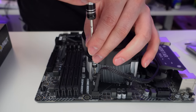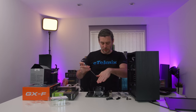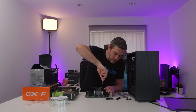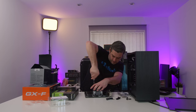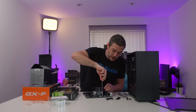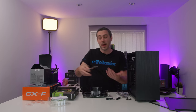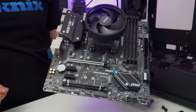When you screw it down, I always go in a cross method. Go for the first one, a little bit of light pressure, just get it to bite enough — you'll see the CPU cooler kind of goes a little bit like this. Then go for the complete opposite diagonal, screw that one down. Again, not fully. Go for the next furthest one, then the last one. On the last one, put it fully down, then go back around and tighten them up until they stop. Don't over-tighten. Our CPU cooler is now on with the 3600X on the MSI Mortar Max B450.